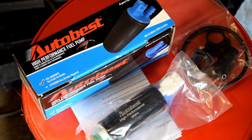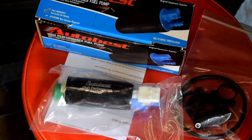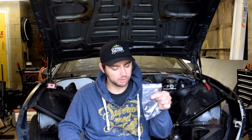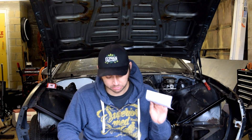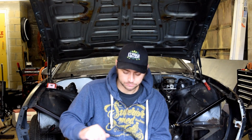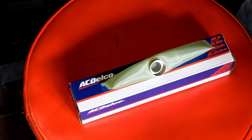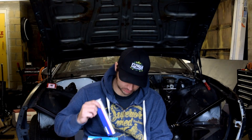To deal with the fuel pressure issue, I purchased this Auto Best fuel pump — it's actually modeled off of AC Delco fuel pumps but a bit cheaper. It's a whole kit that comes with the pump and miscellaneous hardware to help you swap it over, plus instructions which are pretty much useless. If you're gonna change the fuel pump you're also gonna want a fuel screen. I got this AC Delco strainer which I believe is the correct fit — I'll leave part numbers in the description.